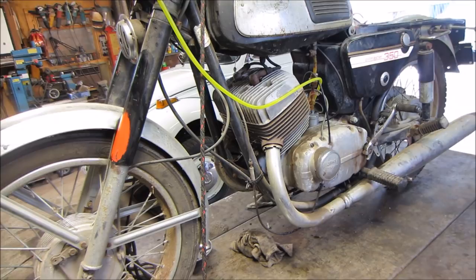This is the 6-volt battery charger. Let's see what we got. That looks a bit brighter — and that is much brighter than what was on the bike. I disconnected the battery from the circuit and now it's just the battery charger running the electrical system on the bike. The high-low ain't high-lowing. I have a feeling I got that socket on there wrong, probably touching both of them together. I took the gas tank off just to get in there a little bit better — it's got to come off anyway.